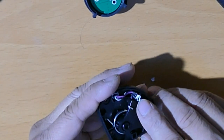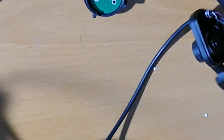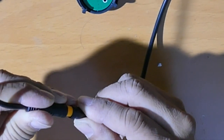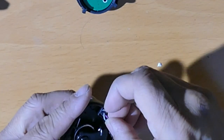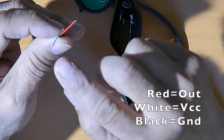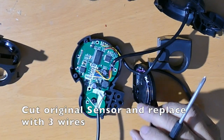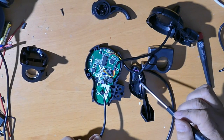The only thing left is to determine where the pins on the Hall effect sensor map to this connector. I bought the female side on Amazon - this plug seems to be universal and compatible with twist throttles, thumb throttles, and other Hall effect sensor throttling systems. I realized the red is the signal wire, black is ground, and white is VCC positive voltage, which should be 5 to 10 volts. I'm going to cut and solder these wires through there, then glue the wires down so they don't rip the board out. The new Hall effect sensor will be placed here.